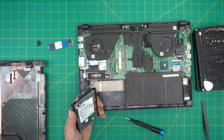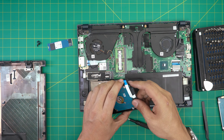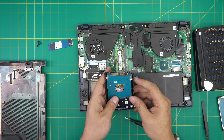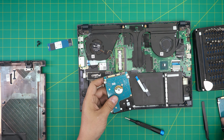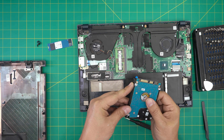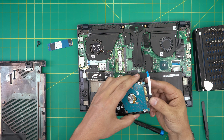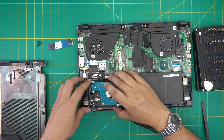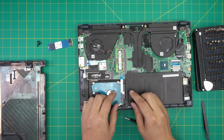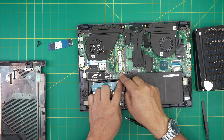This is a Toshiba one terabyte. New SSDs have pretty much the same interface and look identical. To swap the drive, remove the rubber caddy adapter from the old drive — remember the position — then attach it to the new HDD or SSD by placing the rubber legs in the holes. Grab the adapter, which only goes in one way, push it in, and place the caddy back in position.